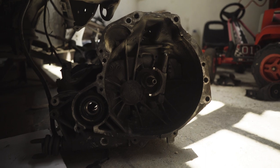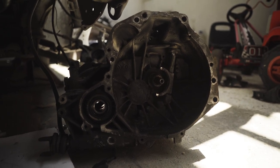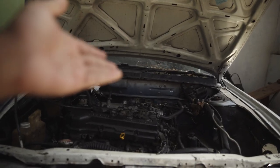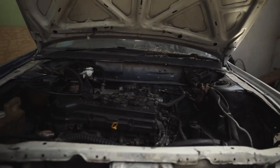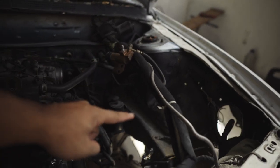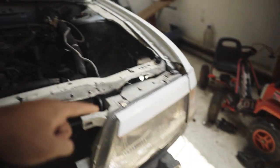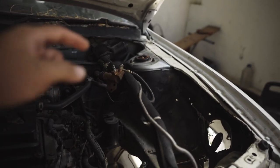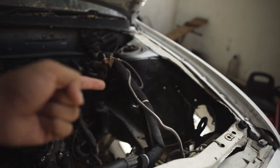I did get one similar and hopefully that works. So once I get that, I'll be able to mount it back up, and the car should be going into gears — that was a problem because of the no clutch situation. I also have to make a gearbox mount for this, because this is the big box so I can't use the original mount that came for the D14. I have to use the SR mount, so I have to build a bracket for that.